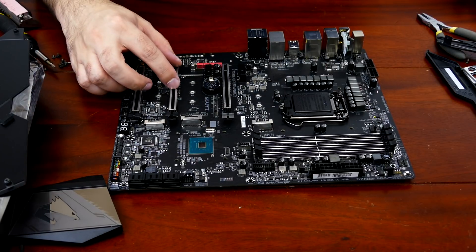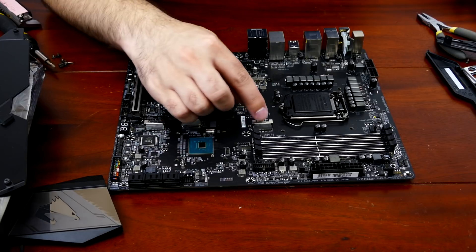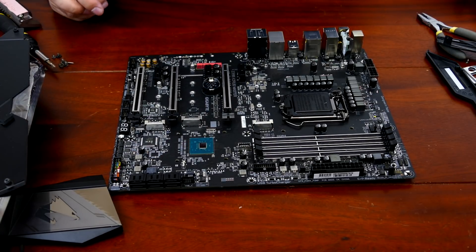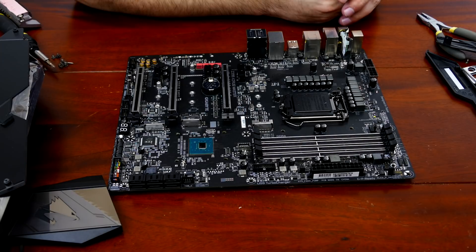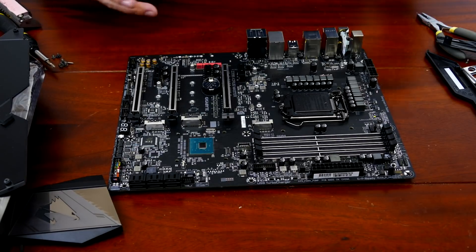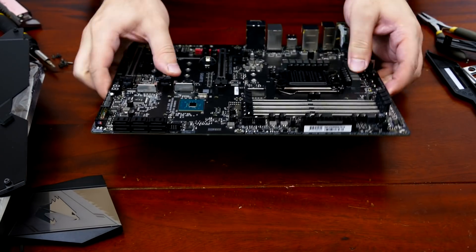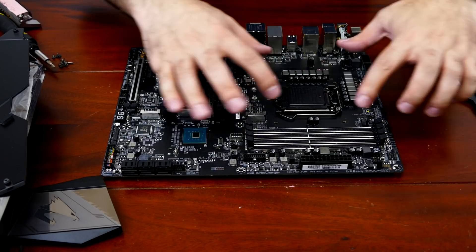There are PCIe switches here — four switches move the x8 slot, two switches move the x4 bandwidth between slots, another switch handles x2, and there's a high-end NXP switch that allows multi-directional switching. So this is a very high-end motherboard. The VRM should do really well especially with the expanded power train and the doubled copper in the PCB. I don't think many of Gigabyte's Z370 motherboards had two-ounce copper, but these Z390 boards do. It makes the motherboard not only stronger — I can't bend this like I can other boards — but also better thermally, and the power conduction area to the CPU has been widened.